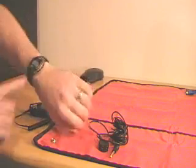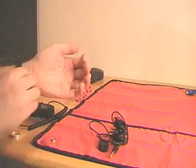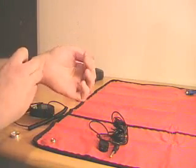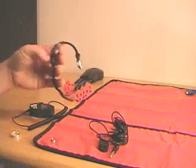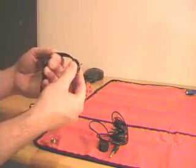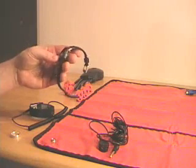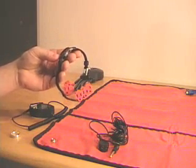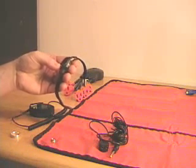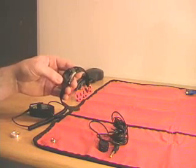Before I get started, I'm wearing a watch and a ring. I want to make sure that I remove any metal jewelry, anything that's dangling. These things can get caught in our components. They can also be ESD contact points. If I'm wearing something metal and I have some ESD built up, anything metal touching metal is an ESD contact point. We want to eliminate that as much as possible. If you have anything dangling like a necklace, you want to make sure you remove that so it doesn't get caught in a fan, doesn't get caught on a cable, ruin your device, and also possibly wreck something inside a computer.